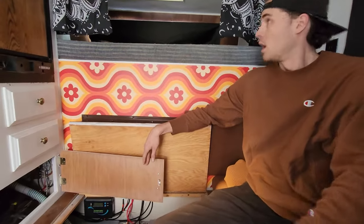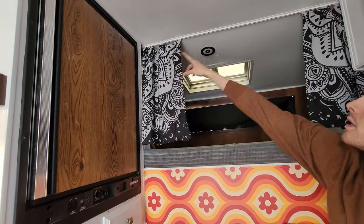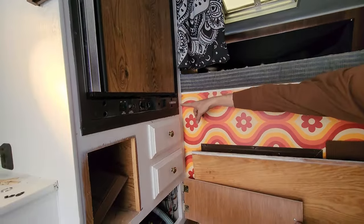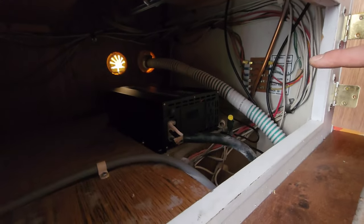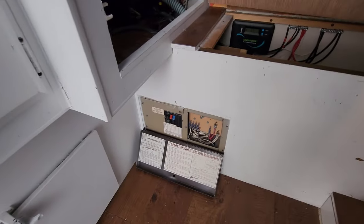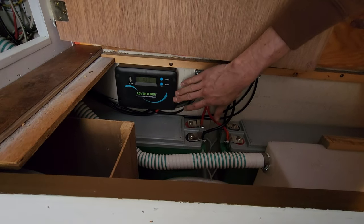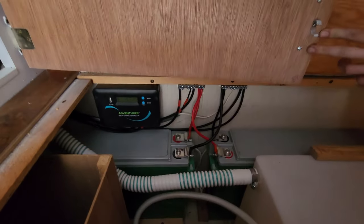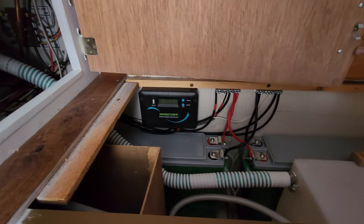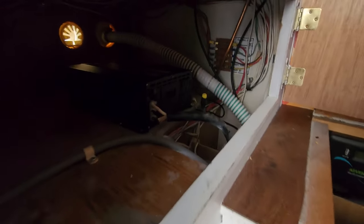Time to work on the inside. We're inside the truck, got solar up and the wires in. We drilled through the bottom to get our hole, ran the wires across here, through a beam, down behind the refrigerator into our electrical. Down here we've got our 2,000-watt inverter mounted right there, tapped into our DC power — or rather AC power — so that inverter is running off over here. We've got the charge controller that came with our kit and everything running into bus bars down to our two main batteries.